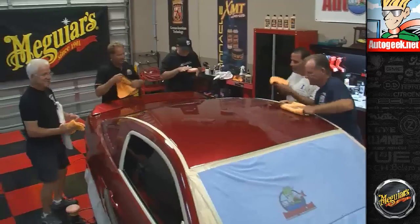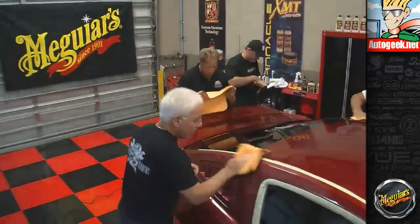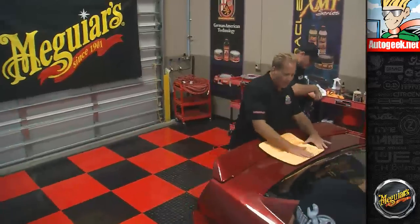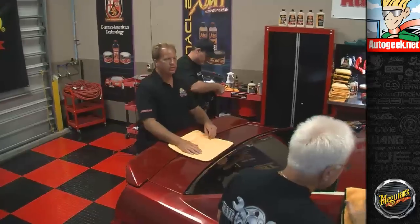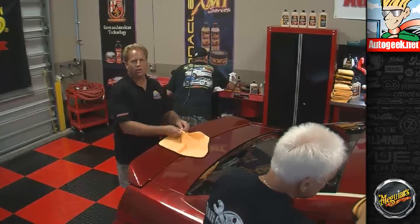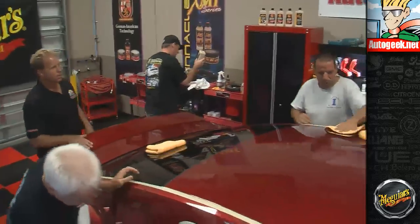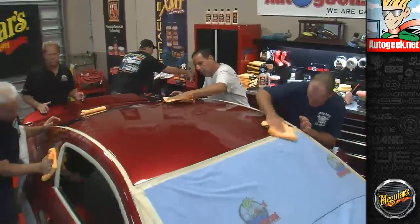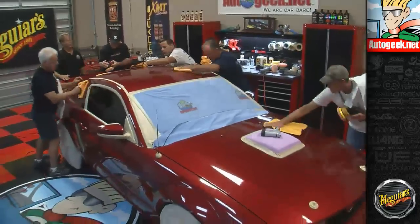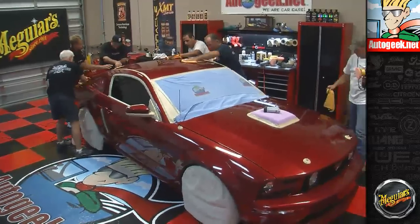Your face? Well, I didn't use my face, but you could. I laid it out flat, and I inspected it visually with my eyes, and if I saw anything that didn't look like it was soft and gentle, I pulled it off, then I ran my hand over it. And if I felt anything, then I inspected closer, and on a couple of these, I actually took a pair of scissors and got something that was stuck in the fibers I couldn't pull out. Then I folded them carefully and stuck them over there for you guys to use. But it doesn't make any sense to polish out a car and create a swirl-free finish and then come back and be wiping and putting scratches in. Okay, let's see your technique here.